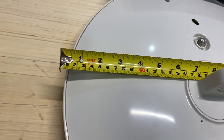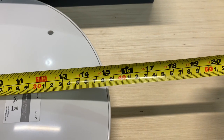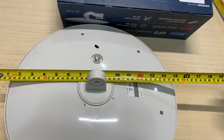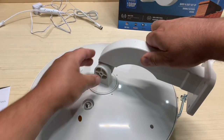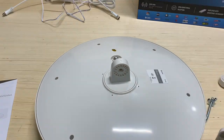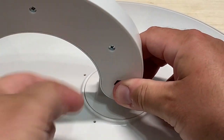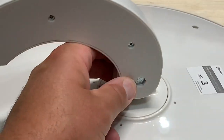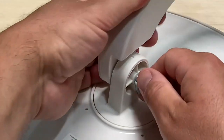The diameter of this antenna is 15 inches, giving it a circumference of 47 inches — roughly the same span as a small directional antenna. Assembling the UFO antenna is simple with no real tools required. To install the mounting arm, line up the teeth on the arm with the grooves on the head of the antenna, install the bolt which sits captive in a hexagonal hole, and install the wing nut on the other side. This allows you to adjust the angle of the antenna.